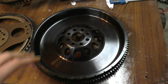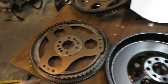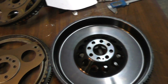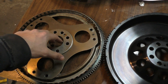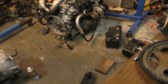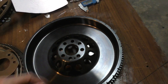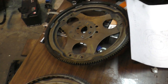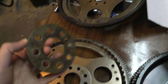The task for this video is to somehow make this flywheel fit onto that engine. The problem is that this is the flex plate that goes behind that engine, and if you look at the bolt patterns, they are completely different. Even the centering piece that centers this flex plate onto the engine is a different size — this one is 46mm and this one is 43mm. And funny enough, the bolt pattern on the CLS engine is different from the bolt pattern on my E55 engine, even though they are the same engines from two different years.